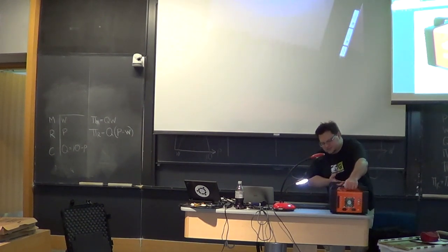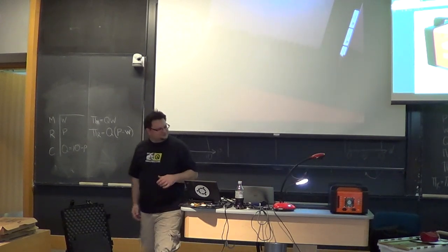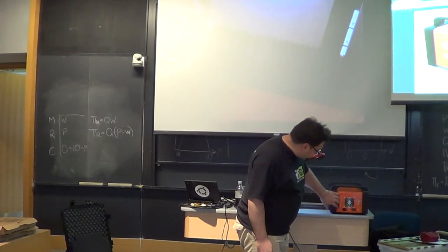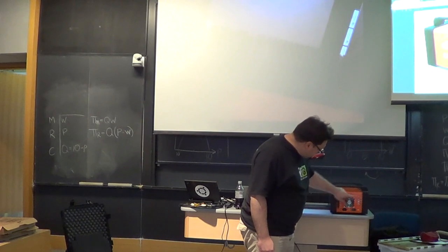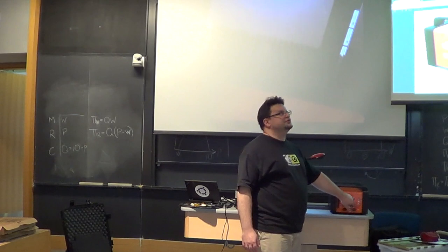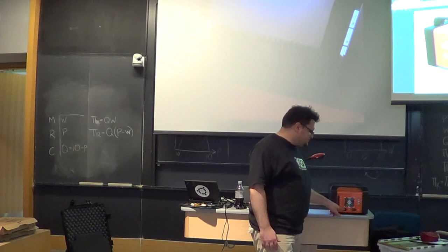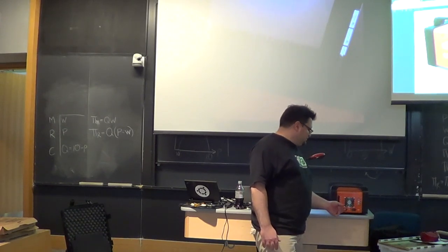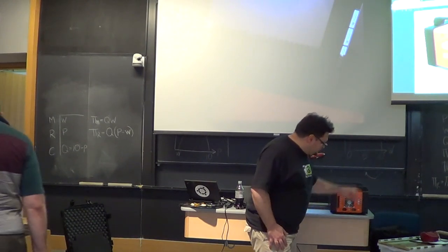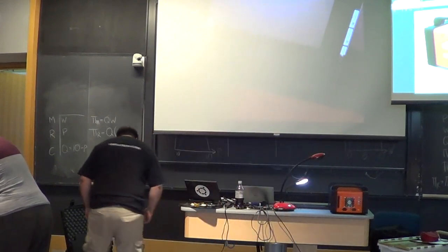We're probably going to use this in one of our OpenStack sessions, but today it's here just as interesting hardware. Now, on the rear, there are network ports. They go to the switch. And USB ports that go to node 1, I believe, and the video, actually node 0, and the video for node 0. There is power that feeds the entire box and power out in case you want to slave a monitor to it. And there is a power button. Up here is a wireless connector, so somewhere in the kit there is one.